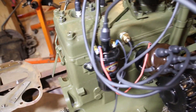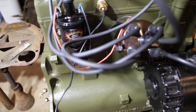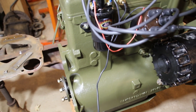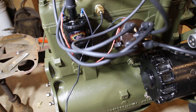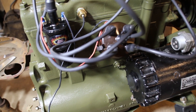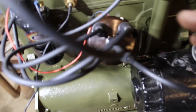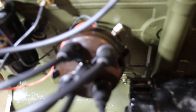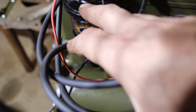Back over at Lou's engine — I get a lot of questions about what I use when I start up engines. First thing I do when I pressure-lube the engine is use a break-in oil: a straight 30-weight break-in oil, high in zinc. When I assembled this it has assembly lube everywhere, cam lube where needed, and extreme pressure lube where that's needed. I always start with my startup distributor, which has a Pertronix setup in it, with the Pertronix coil.